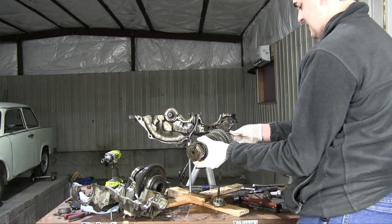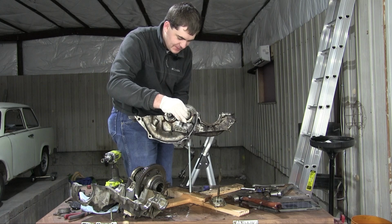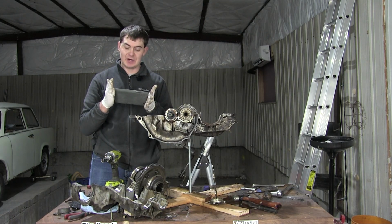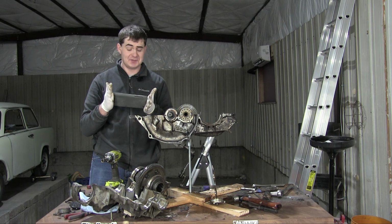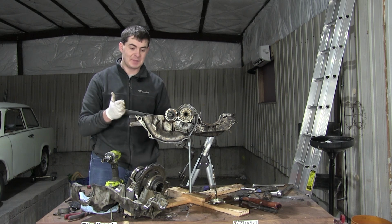Yes, this goes back here somewhere. Yeah, that goes in there, something like that. There we go. That's how that goes in there. Use 2 screwdrivers and lift the casing lower part at the lugs cast on for this purpose, which I did. During this operation, the shaft should remain in the casing upper part.